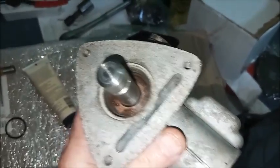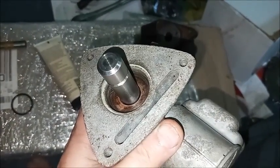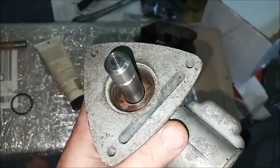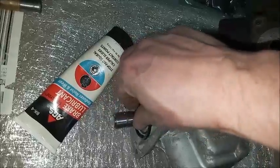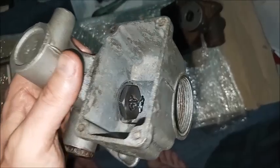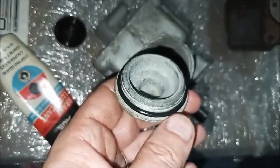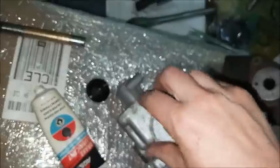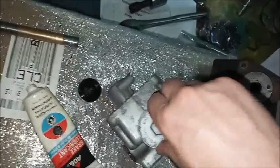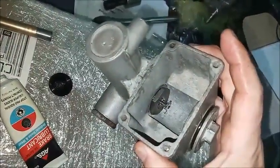Now the snap ring's in place, just put the vacuum seal over the plunger. And then finally fit the O-ring into the groove. The Bendix will need its covers installed. Front cover and its O-ring. It's a 3/4 inch socket. And then the top cover has 4 screws and a gasket.